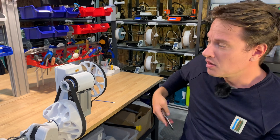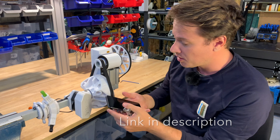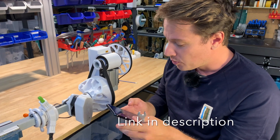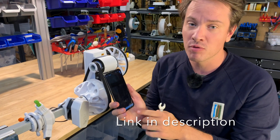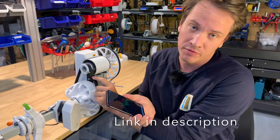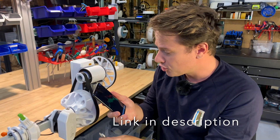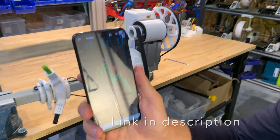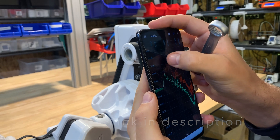There's a little bit of noise here in the hall, so let's see if I can do it on my phone. We go into an analyzer app that analyzes the sound input from your phone and can give you a frequency reading. We want this belt to resonate at a frequency of 210 hertz — sort of in that ballpark. I have an app here that's going to show me the sound spectrum, and I'm looking for around 210.